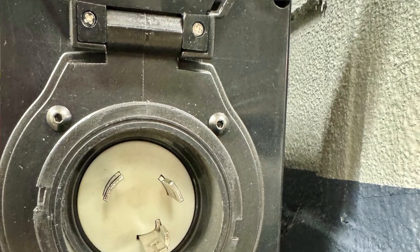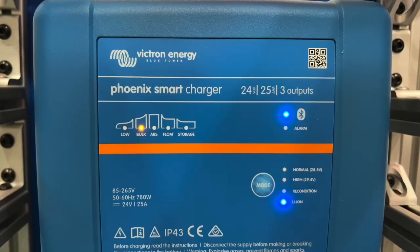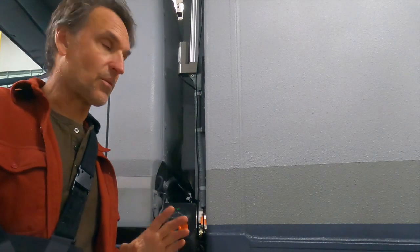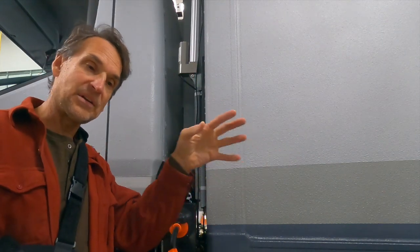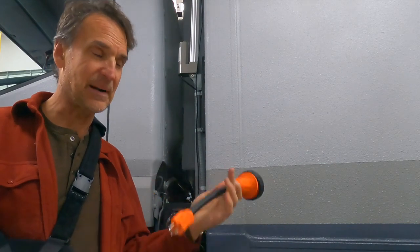I have the same 30-amp connection on another side as well, so with one dongle and one cord I can buy different plug adapters for anywhere in the world. That plugs into my standard 30-amp connection going to my international shore power converter, which supports 85 to 250 volts at 50 or 60 hertz — it'll run anywhere in the world. There's also another 30-amp connection and port near the back of the camper for convenience or campgrounds where that side is closer.